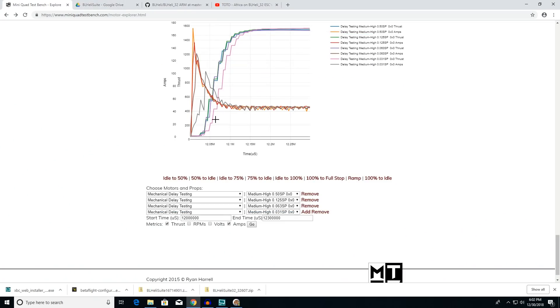Do you leave this at default on all yours, or do you have a value? I haven't really run into issues that often. And there's really no reason to increase it, since most of the time we're not hitting that limit anyway. You could probably get down to somewhere between 10 and 20% without causing a dramatic increase or decrease in handling. If you have a thrust stand, or if you're a racer doing laps very consistently, you could compare. Most pilots, though — if you lower it too much, you'll get a reduction in output power, and you may not even notice the difference because you're just not that sensitive. What's the difference in thrust? It does get there — just slightly slower. How much longer does it take to get there?